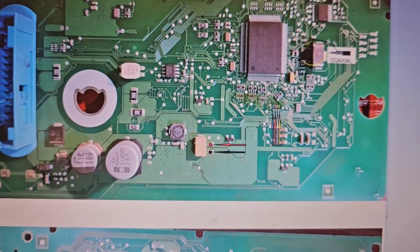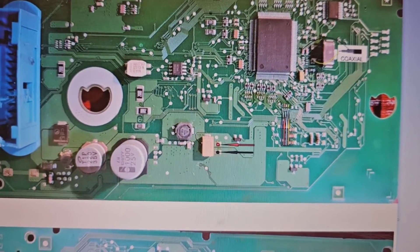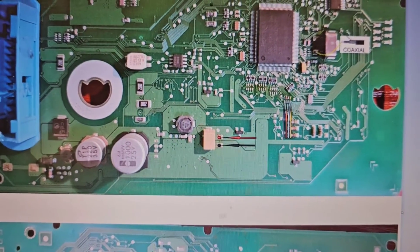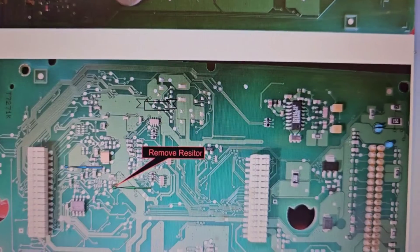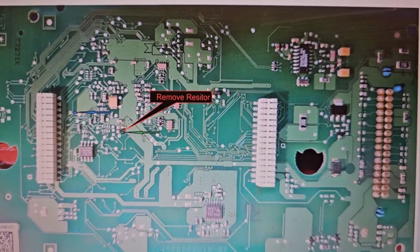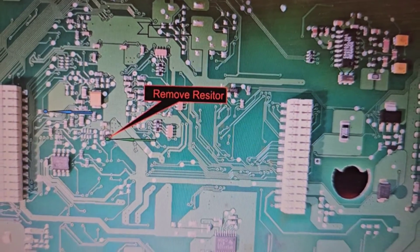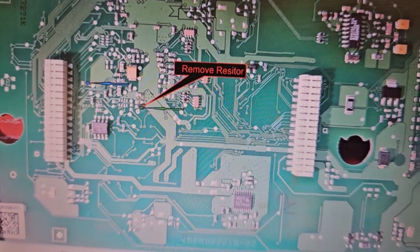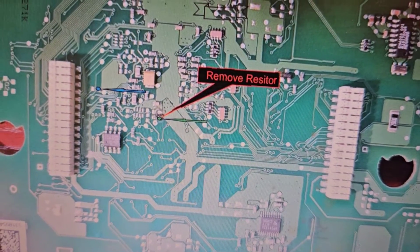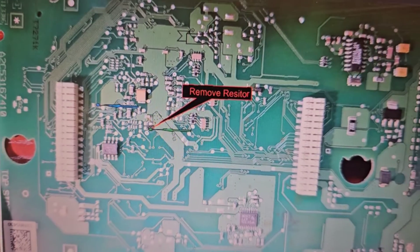That Micronas - you can read the EEPROM to get the PIN code and CS code, and then you can program it probably with the Autel or Pad when you've got the EEPROM. But in this particular case when we have ZedFull we don't need to do it. Normally when you remove the dash it's that Micronas, and what you need to do is remove actually some resistors.